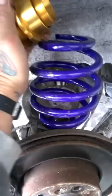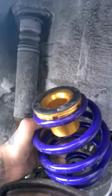When you install these springs with the coilovers, this is how they're going to be going in — just like this. It's not like a Honda where the sleeve is upside down; it goes in like that. I'm going to adjust this all the way back to give me as much room as I can, and then I'll adjust it correctly. That bump has to go into this hole, but it might not want to go in right away, so after you assemble everything, put the tire back on, put the jack underneath the control arm, jack it up, and it'll slip right into that bushing.